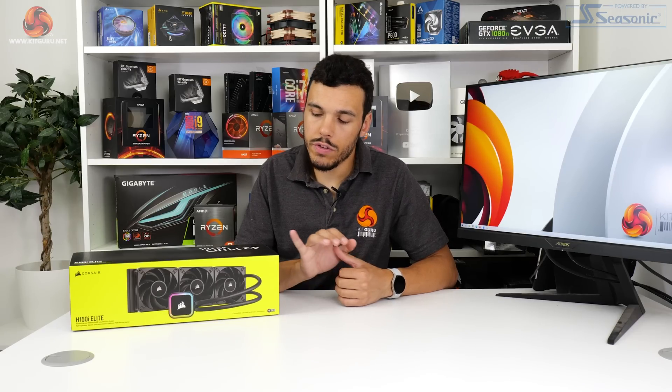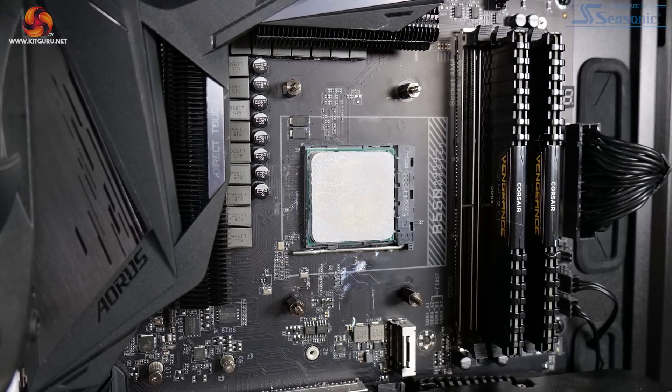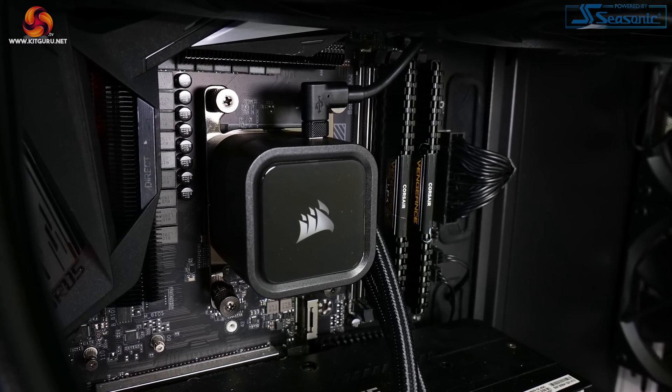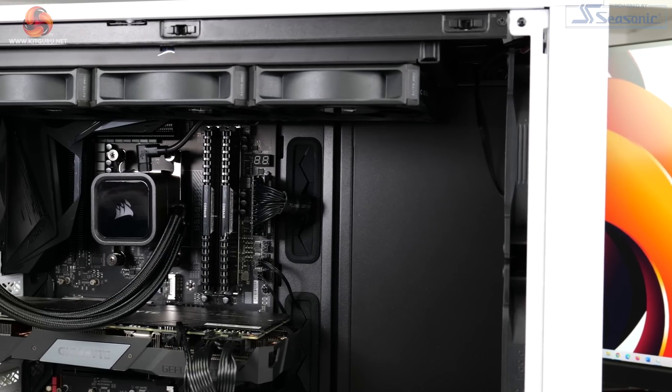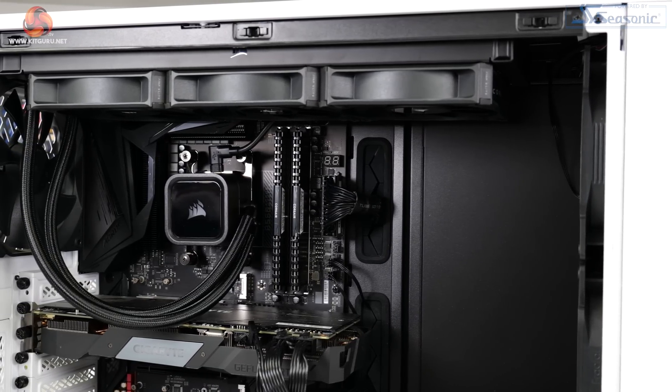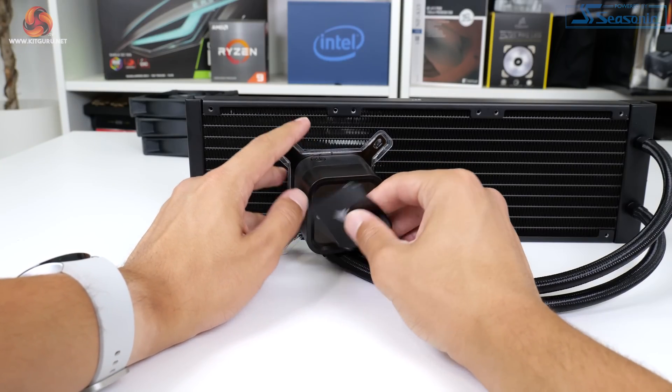The warranty for this £164.99 CPU cooler is five years, which is exactly what we'd expect at this price point. Installation of the entire cooler is very easy, even as far as connecting the cables. You install the relevant standoffs on the default AMD backplate, then switch out the Intel cold plate brackets to the AMD ones, and the block with its pre-applied thermal paste can be mounted. Then the radiator and fans are mounted, and finally one can connect the USB-C cable to the pump block housing and connect all the relevant cables including internal USB 2. The mounting process is quick, very secure, and the cable management is clean.